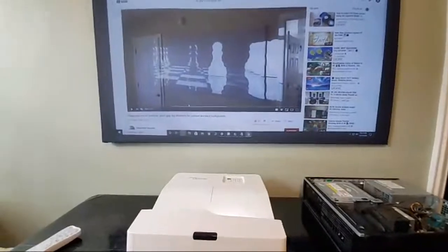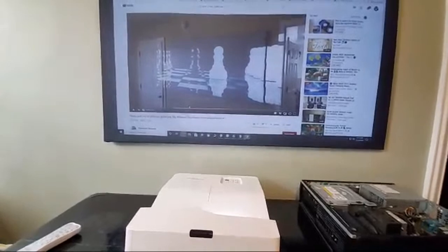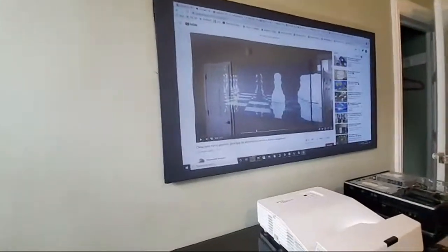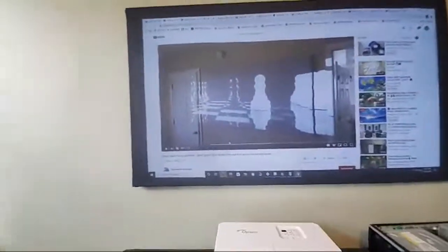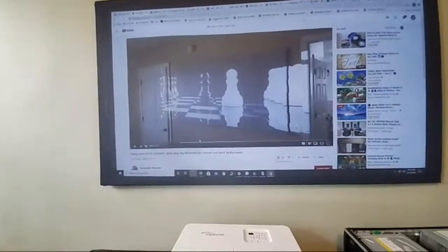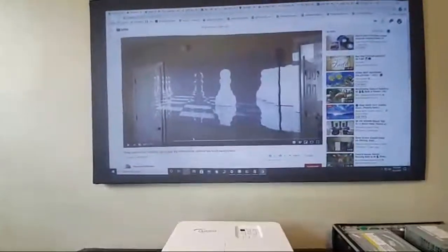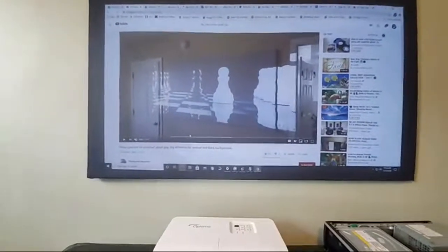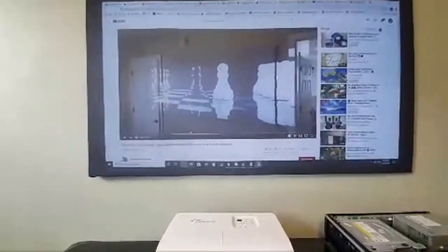The problem is they're depending solely on the projector. That's why their lumens are so high. They'll use a white screen, of course, and most of them use all white screens anyway. So they go out and get this high power projector thinking that with 50,000 lumens at 30, 40 feet back, they're going to lose about 10, 20,000 lumens at the most, and at least 30,000 will make contact with the screen, and they'll be able to pull off a beautiful image. They can't figure out why, when 30,000 hits that screen, it looks so white. With 30,000 lumens, you're going to whitewash your screen.